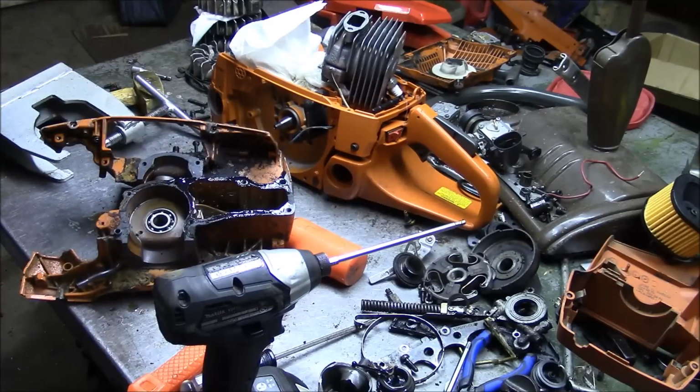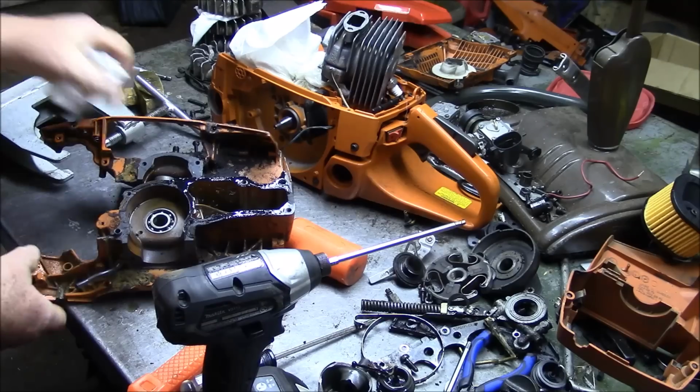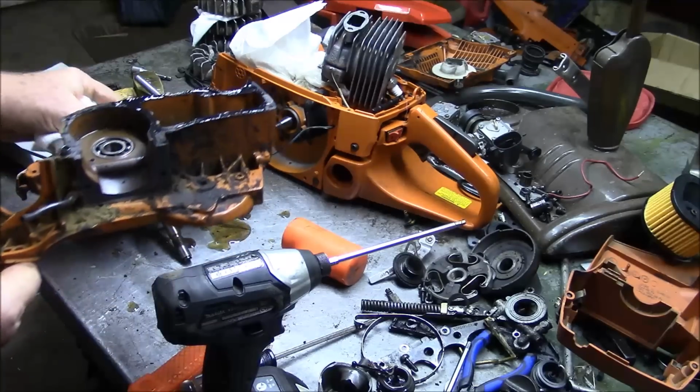For that matter, just to add insult to injury, I'm going to pull that freaking bearing out of there. I'm going to stick it in another saw and let it run another service life, just to make a point. Anyone who argues with me, because I do get arguments, on whether or not that steel cage bearing concept matters. Let's pull the other one out.